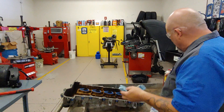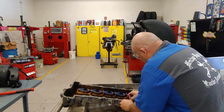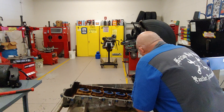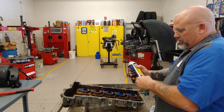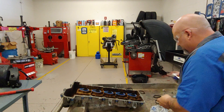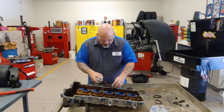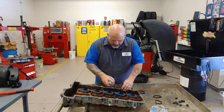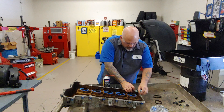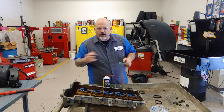Remember when you're using brake cleaner, have your safety glasses on — get that in your eye and you are going to be a sorry individual. You can use the wand and put it in there — less is more, you don't have to hose it down. Get down in the channel and let it run downhill; notice how I have it on an angle so the brake clean can run through. You may need several pieces of paper towel to get it all cleaned out.